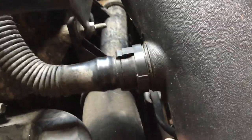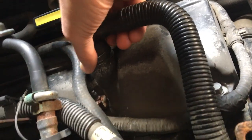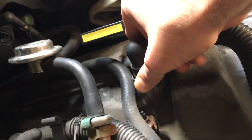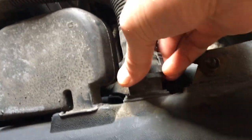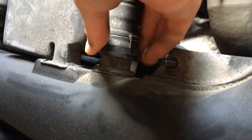This clip is an interesting one if you haven't dealt with it before. I'm going to take it off on this end because I'm going to be getting into the valve covers for some work later. You pinch these grips — one on each side — and that kind of unlocks it, and then you can just pop it right off. There's another one over here, so I do the same thing: pinch it and pop it off.